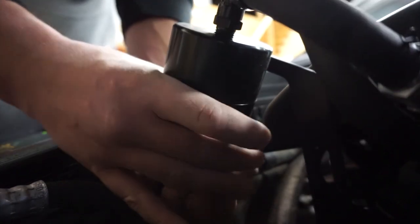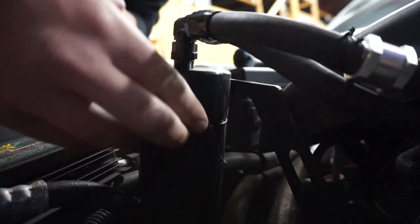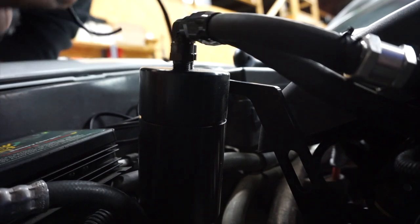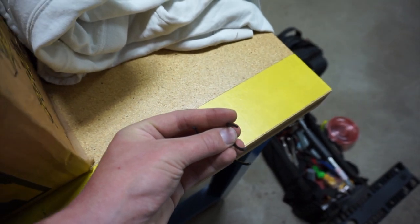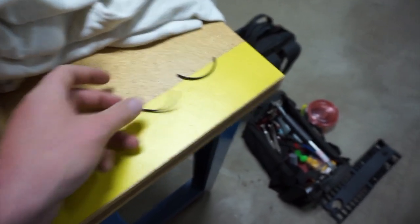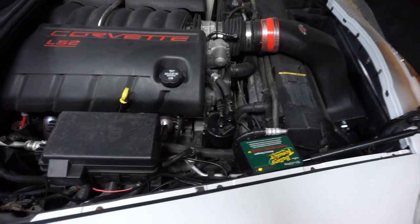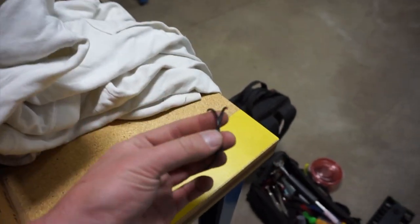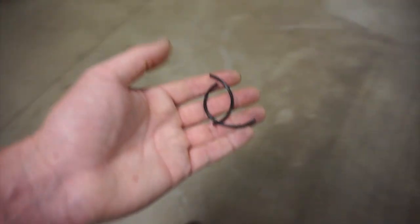It got really tight on there - there it goes. A gasket appears to have dried out and like locked itself together. It's almost like whatever the manufacturer put on it dried out and made it stick to the aluminum on both sides - on the threaded side and the female side. It was really, really tight taking it off. You might have to put motor oil around it or something. I did see on the website when you buy these, extra o-rings were an option, and I didn't buy them, assuming they're reusable sort of like a gasket, but apparently you need to buy them.